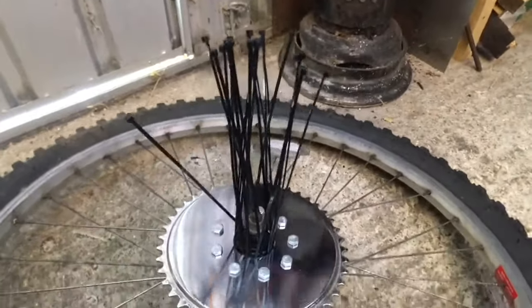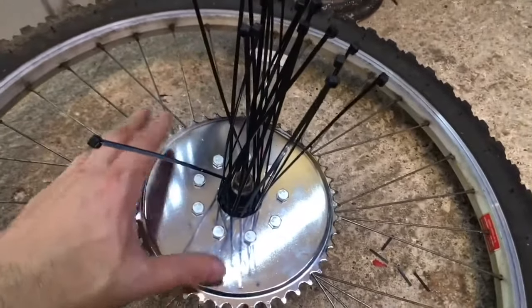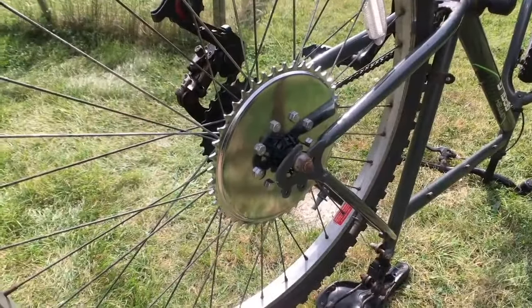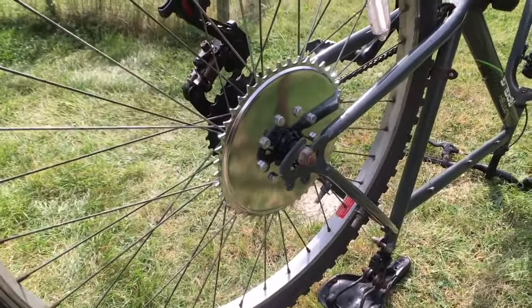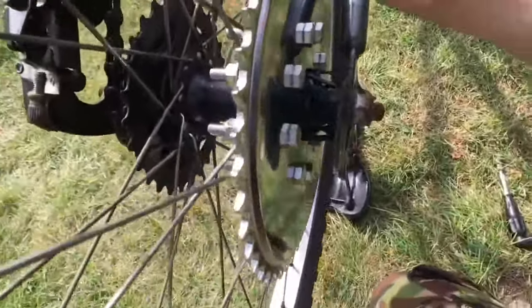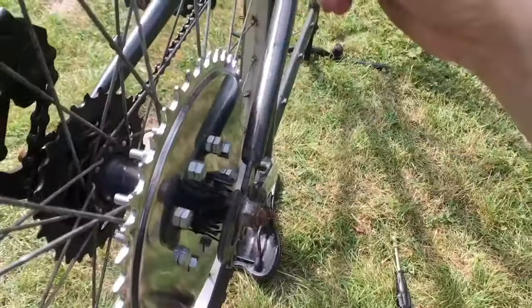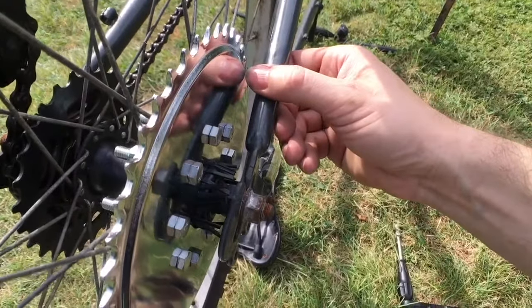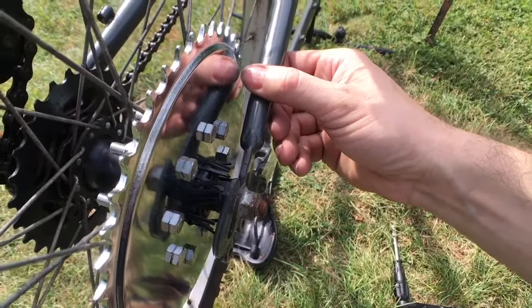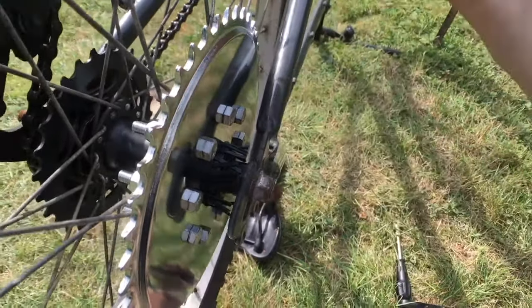To space the sprocket on the hub, I've used a load of cable ties and just pushed them in all the way around until the sprocket is central on the hub. Once the sprocket is on and tightened down, you need to true it so it's square with the hub. I've been putting my fingernail against here so I can feel for the high spots, and then tighten the high spots down to square the sprocket up to the hub.